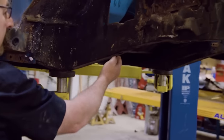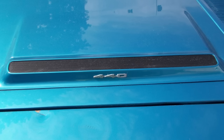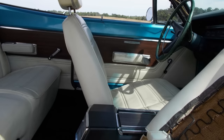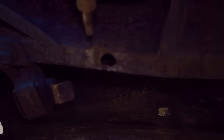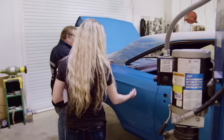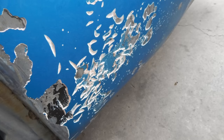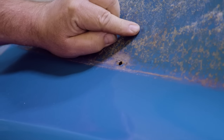When I talk about sins that are hidden, I'm talking exactly about this car. You look at it in the beginning and the original photos I bought it, it was beautiful. Even when it showed up, it looked great. But underneath all of that, it's like that phrase about building a house — the carpet hides a multitude of sins like rotten floors. In this case, paint hides a multitude of sins like rotten floors. Every single thing on this car had filler on it from front to back. On the quarter panels and the roof, same things — they looked good outside, but as soon as you started chiseling away, you saw there was no metal underneath. The car was basically sculpted from Bondo. A bubble's never just a bubble — it's always a sign of rust underneath.